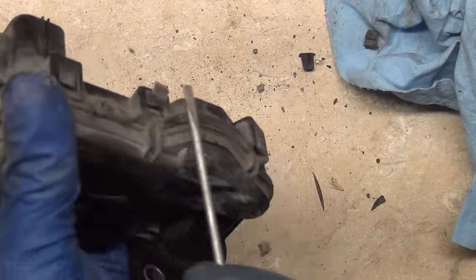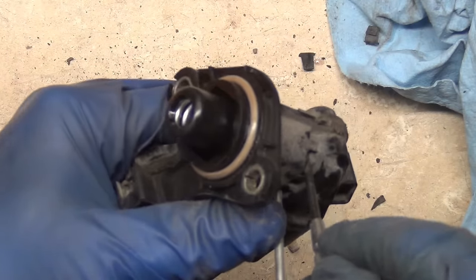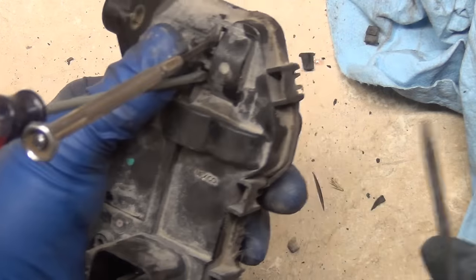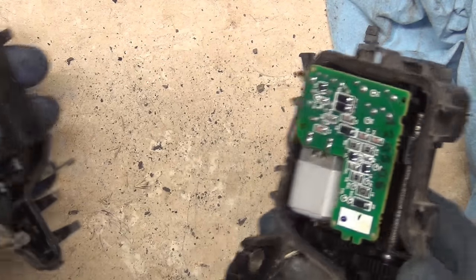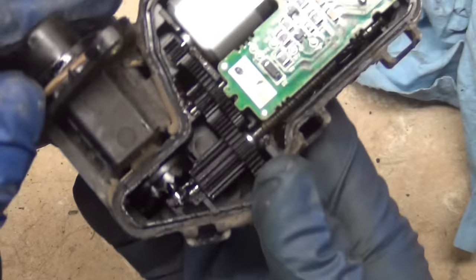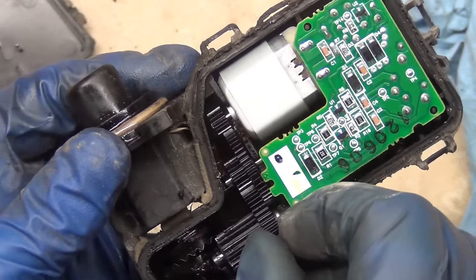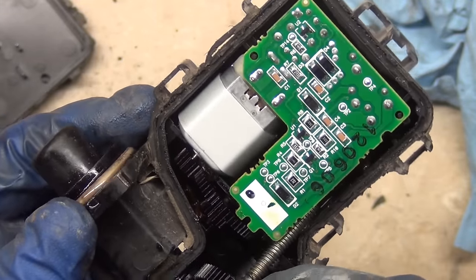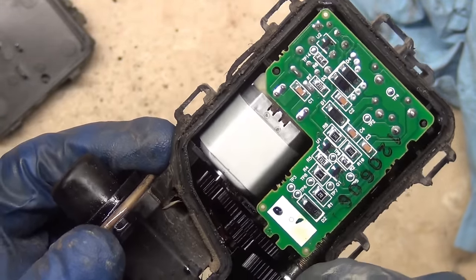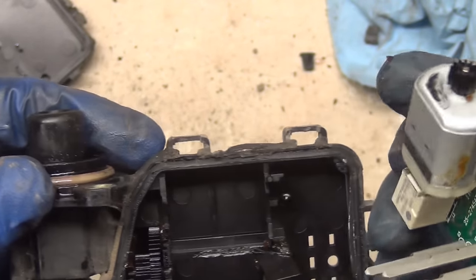When these lock up and they're glued together, there's no going back. Well, let's see if we can get this to separate. If you were to just put a whole bunch of stuff in there and hold it, I bet it would work. It's coming apart. So my guess is if Dorman made it — they make everything. So what I'm looking for is something that's cracked or popped in these nylon gears. I heard a plastic popping noise, but it was actually the case of the actuator, and it was caused by resistance in the transfer case. The motor's good.